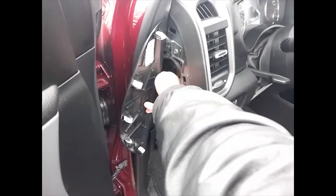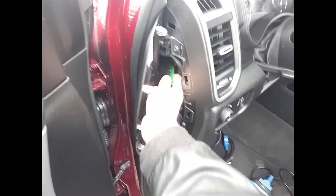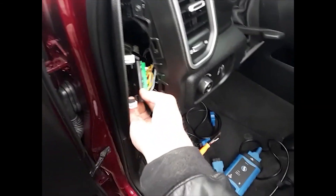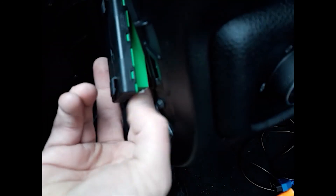Now we're looking for those green wire connectors back there. The easiest way to get them off is to reach up from the bottom and pop it up. On the 1500, you can usually pull it right out the side here without too much issue — it has a little more wire slack than the larger models.